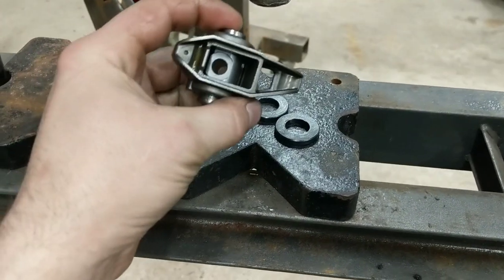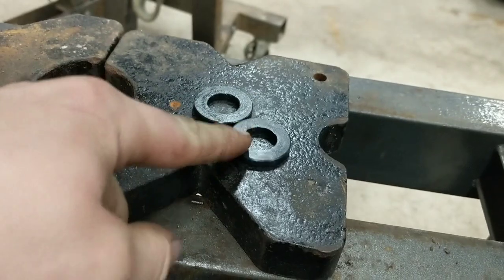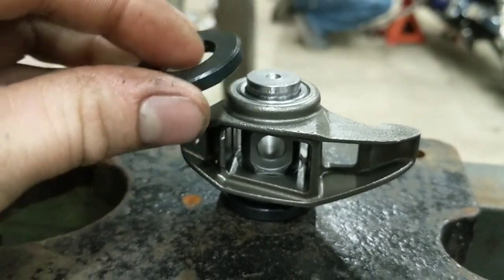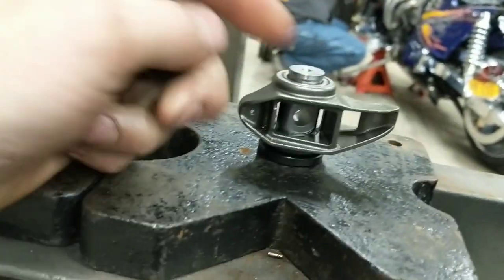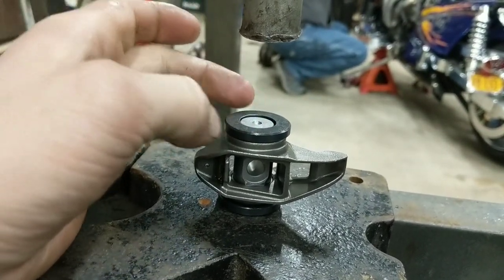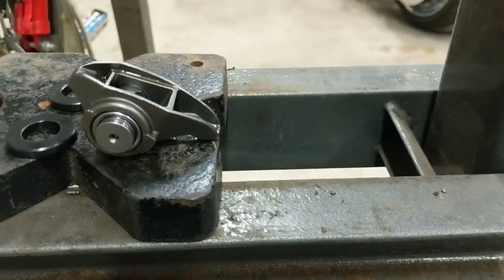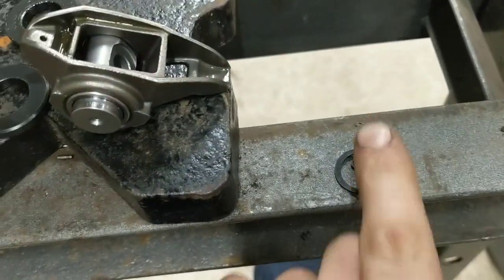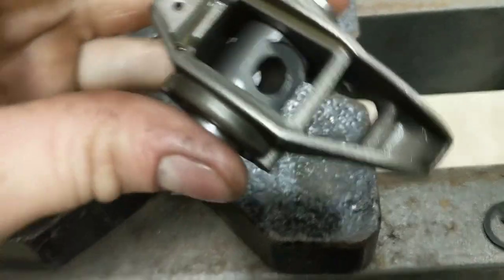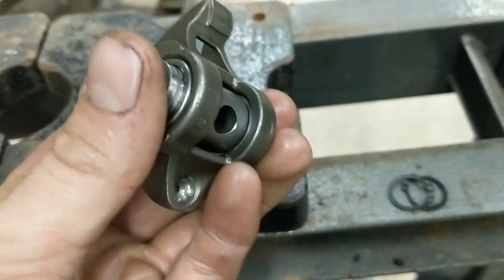Now that you've seen how to press everything apart, here is one that I just pressed back together with the new bearings and the trunnion shaft itself. They give you these installation washers - the whole purpose is it gives you the perfect thickness for the amount the rocker trunnion shaft actually sticks out. You just set the bearing here, set your washer down on top with the shaft centered in the washers, and push them together. Then we take a couple of snap rings - they give you two extra snap rings and two extra bearings in this kit - and put the snap rings on to retain everything so none of these bearings can ever walk out the side of the rocker. It's a lot more stability for high RPM and high valve spring pressure situations.